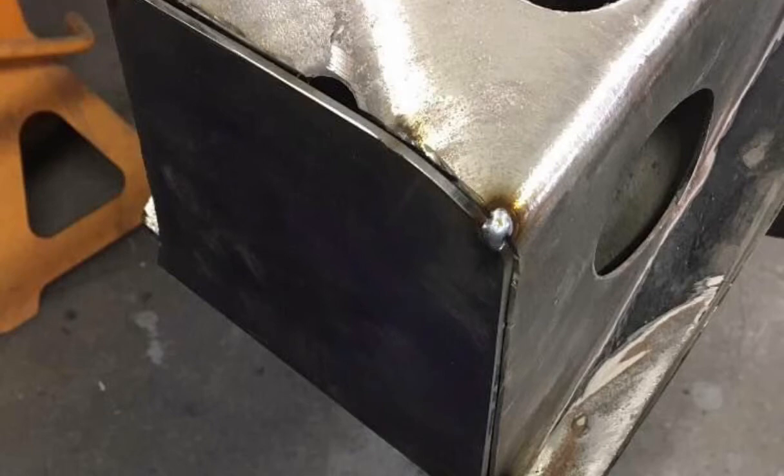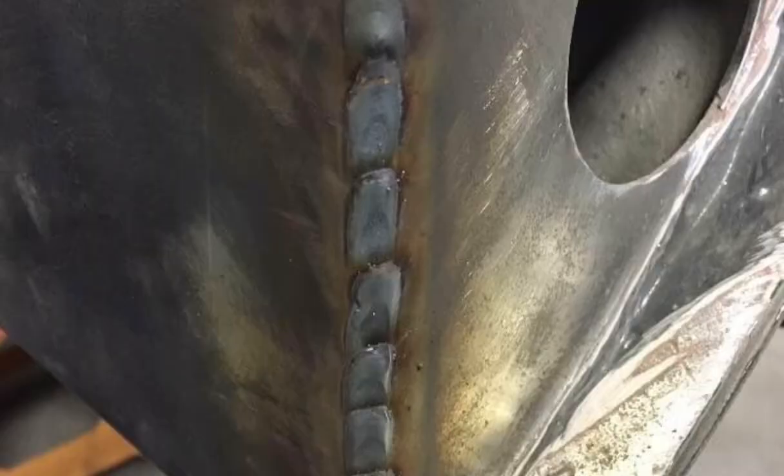The front K-section has been cut, leaving a hollow area. I've made up a couple of little plates fitted to the shape of that area — you can see them tack welded here to one side, and the same on the other side out of picture. I'm going to weld those in really well because we're going to be welding our crossbar to that plate. Here is the actual weld — after tack welding everything, I stitch welded, going about every three-quarter inch and just keep lapping. This gives me much more control than running a straight bead all the way up.